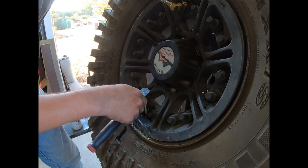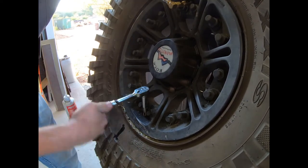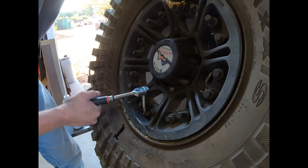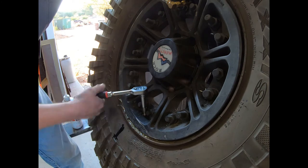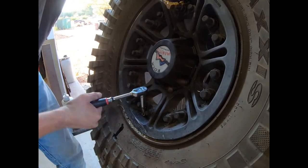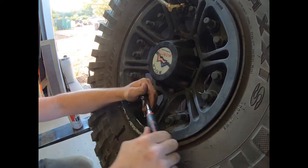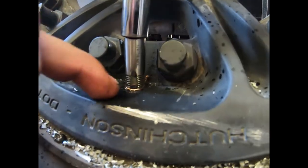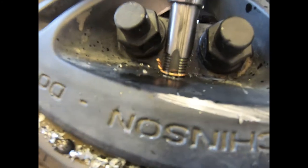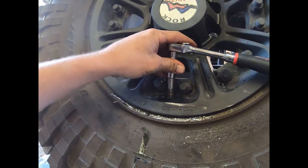Now I'm to my point and I'm just going to do a couple more turns, then back it off. Once you do your first one, you set your depth. The reason I use a piece of wire here is because my wire is bottomed out all the way against the rim, so I know I'm at my depth. Don't run your tap all the way in without checking it every half turn on the first one. Once you get your first one done, you can set your depth gauge, and on your second one still check your depth to make sure it's good.